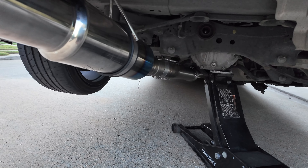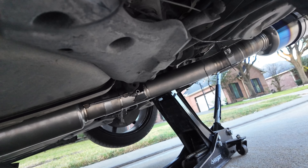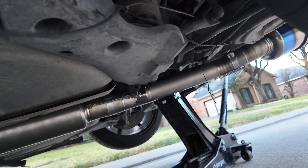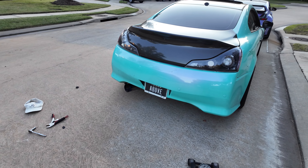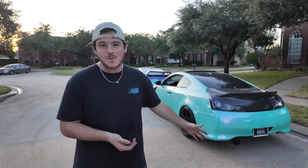If you're new to the platform and don't know much about Tomei, here's a brief rundown on how it works. As you can see it is open right here, you have a couple of openings, the pipe is expanded just a hair. There are clamps right here to hold springs, and there's going to be a spring that will squeeze those two pieces together. We slide that right in there — you can see it slides in, you match the springs right there, and that squeezes them together. There's also a clamp that goes around here for extra secureness.